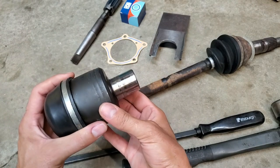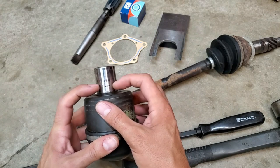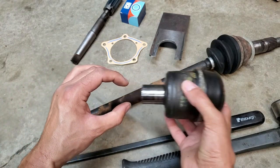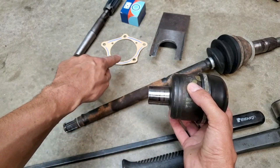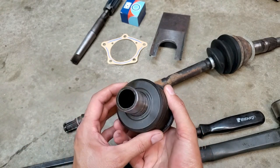On the green car I found that the axle seal itself was leaking, and it was on the right hand side. In order to change the seal you have to withdraw the joint, then remove the cover plate and knock out the seal. You'll also end up using a new gasket when you put it all back together, and I always use sealant on the gaskets to make sure they stay dry and clean.